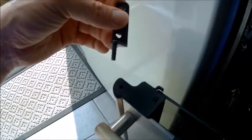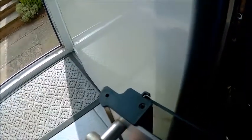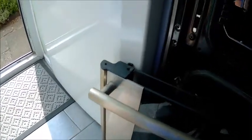So what I'm going to do is try to bend this pin back a bit — a millimetre or so — just to try and compensate for that wear. It's all I can do. Other than that you just have to lift it every time you want to shut the oven door, which is a pain. But I'm just trying for a solution anyway.